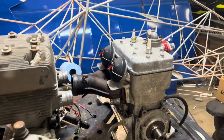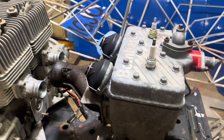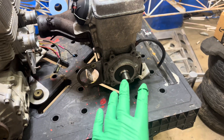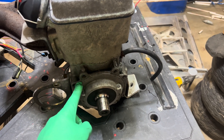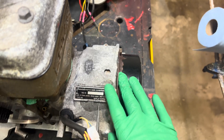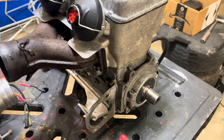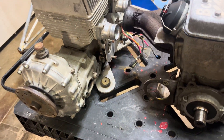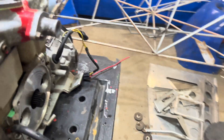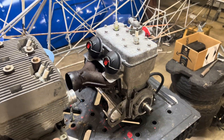We got the snowmobile engine out on the right and on the left we got the 503 from the plane. The 503 was a 50-horsepower engine and we're going to be replacing it with this 107-horsepower snowmobile engine — should be a little more fun to fly with that motor. On the front of this 583 you can see casting marks for mounting up the gearbox, which is really handy. I can machine that down myself. I want to add the electric start over here to replace the recoil, and also swap the engine mounts. I'll take the exhaust off, remove the previous electric starter bracket, and just see how well I can convert this thing into an aircraft engine.